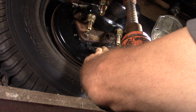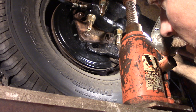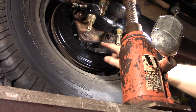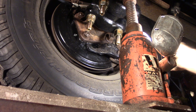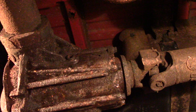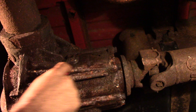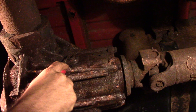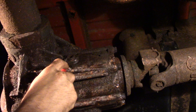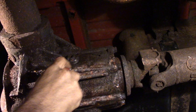I don't have much drag on this. I think I heard some drag. You just go down, down, down — once it's got drag, that might be enough. Yeah, I think that's enough right there. It's a little hard to turn, so I'm going to back that off one or two clicks. Then while I'm under here, fill that oil, drop this on the ground and see if that works. Back it off one click — up is in. So now let's see if this will come out. I don't expect to put a lot in here, not a lot fell out, but I've got to make sure the bearings are getting proper oil for sure.